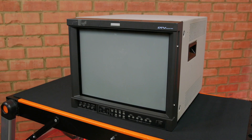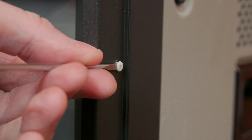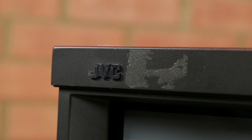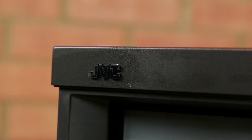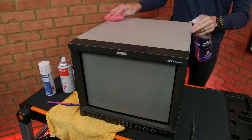The screen now looks much lighter in colour without the filter. Before we test it out, time for a quick clean up — firstly removing these bits from the missing widescreen bezel with a screwdriver. There was some glue around the JVC badge which was removed with IPA. The sticky residue on the top didn't come off so easily, but some label remover spray left to soak for a few minutes did the job. And finally a good wipe over with a cloth and some mild detergent spray.